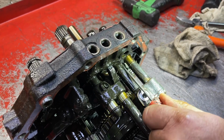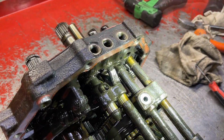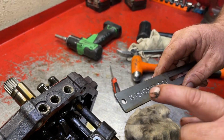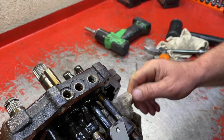You're not gonna use pliers. So you can use the 2 same screwdrivers that you used for the bigger snap rings back here. We have a tool for it, but you can use the 2 flat screwdrivers. We're gonna use the Yota1 14mm clip remover. Specialty tool. Yeah, the screwdrivers get kind of annoying on these little guys.